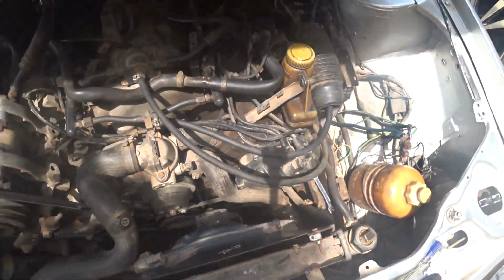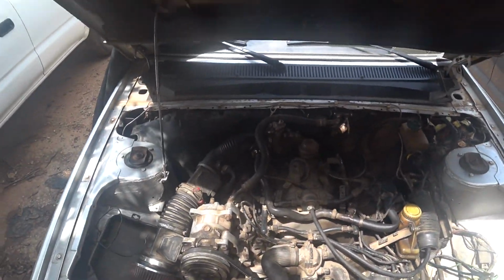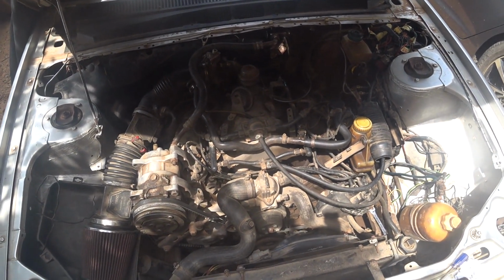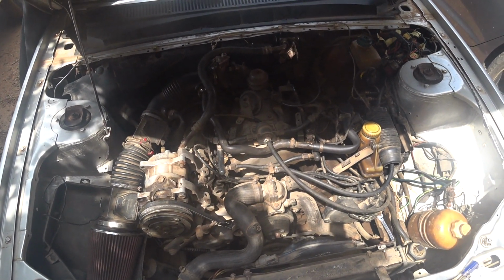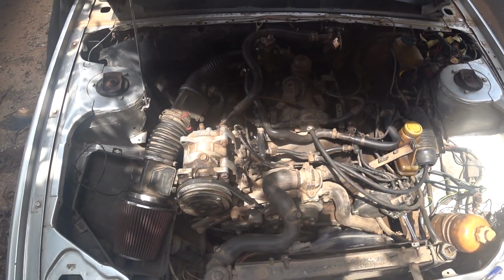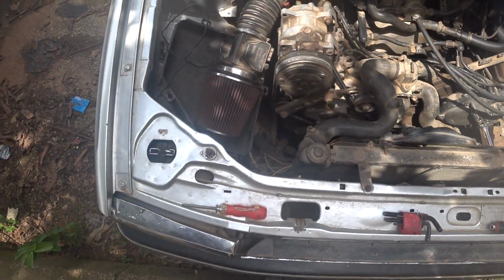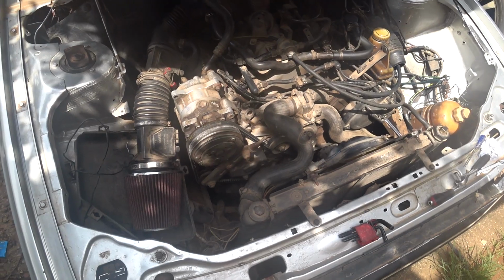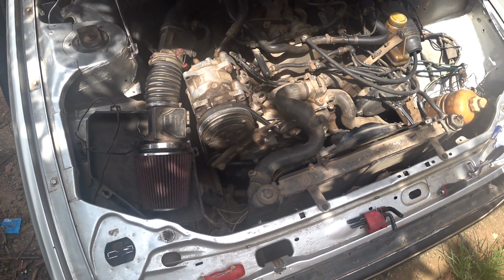So we'll see. The major suspect is the wiring harness. Like I said, something like this happened in the past. Not exactly, but similar, which eventually led to the car being parked for about 3 years because it refused to start, and eventually it was the harness, and I found one wire cut inside. There's no way I would have known if I had not removed that harness. So that's why I'm still suspecting the harness could be the cause.